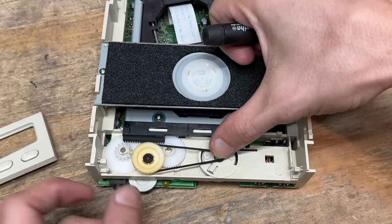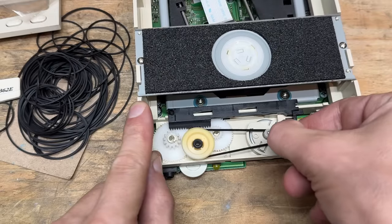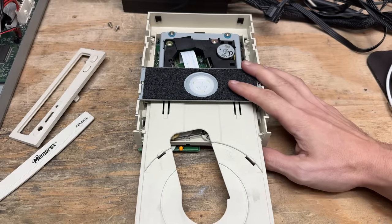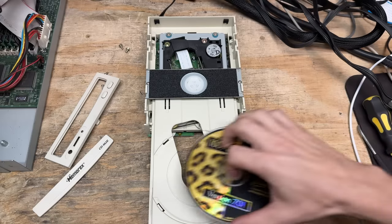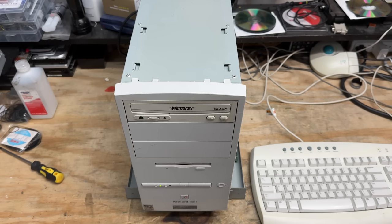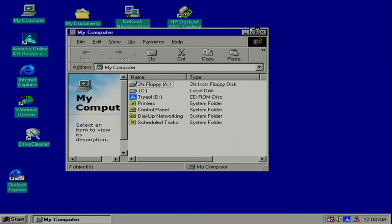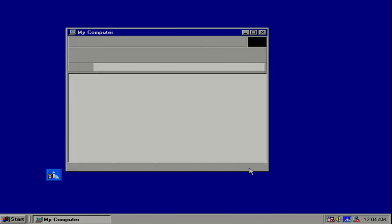Here's a belt that might work. Yeah, that might do it — let's see. Yeah, there it goes. Working great. Might as well wipe that disc tray out — pretty dusty. Before we get it back together, let's just make sure it spins up. And yep, sure does — so there's a good chance this drive works fine. Let's get it back together. And it is working — AOL 7.0 seemed appropriate. Let's get out of this. All right, well that CD drive is saved.